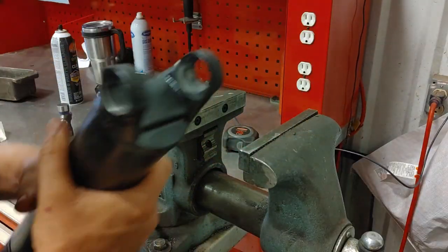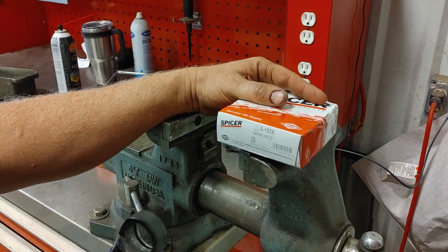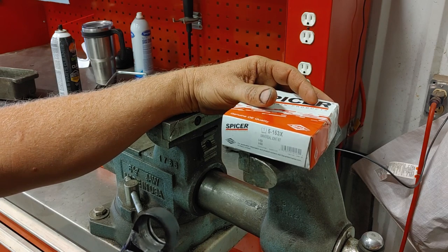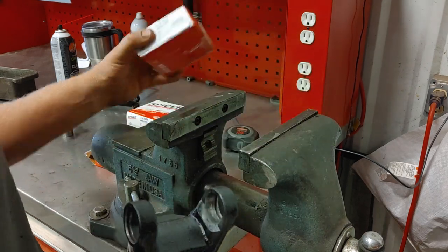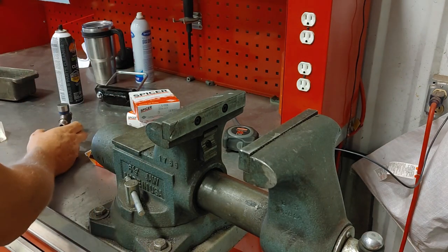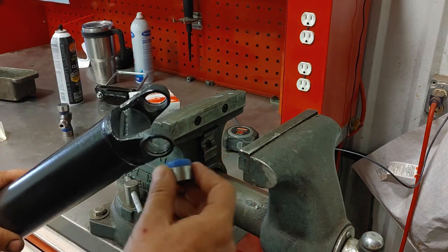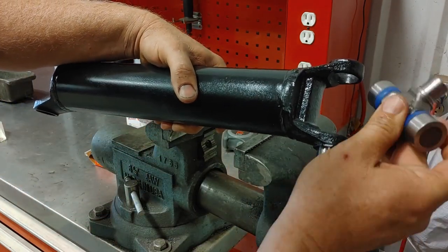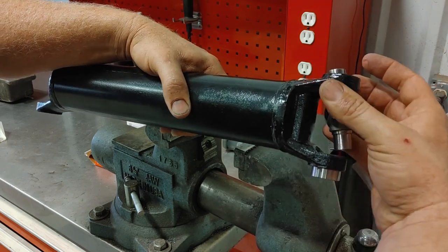So I made the tough decision to spend what inheritance my kids would have had on universal joints. Good quality U.S. made ones. They aren't cheap anymore. These are Spicer 5153Xs. Parts store had them in stock. And they are greasable, so for what it's worth, there it is. And I liked it best if the zerk faced in on the shaft. Well, I think I already went too far. There we go.